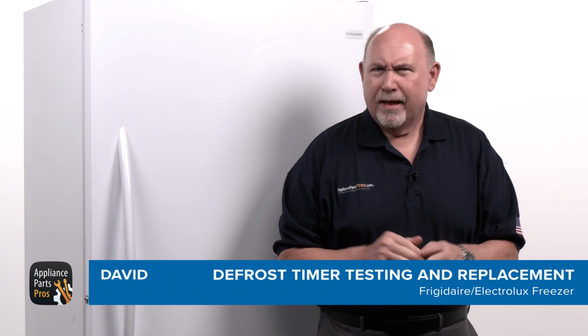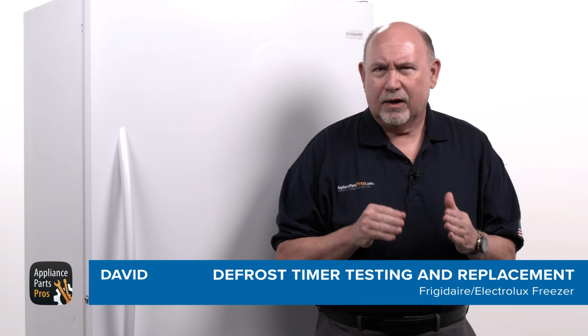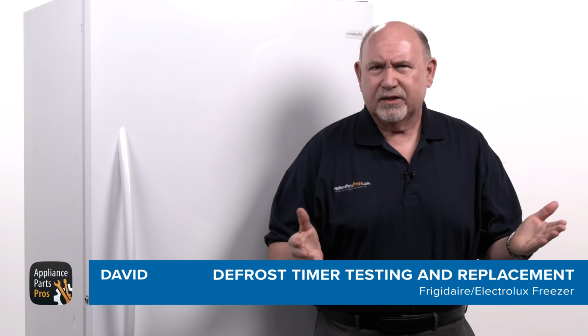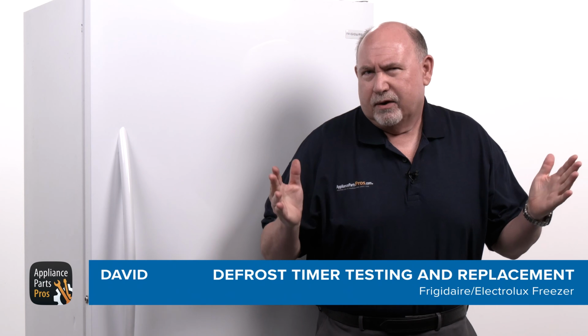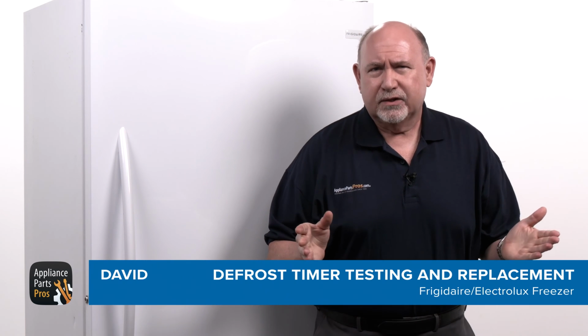Today I'm going to show you how to test and replace the defrost timer on a Frigidaire freezer. The defrost timer regulates the intervals at which the defrost cycle occurs in your freezer so that it works correctly and prevents excessive frost buildup on the evaporator. Most timers will go into a defrost cycle every 6 or 8 or 10 hours. You might need to change out this part if it fails testing.